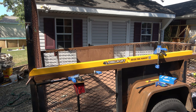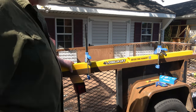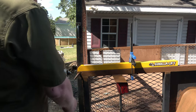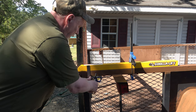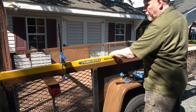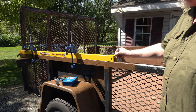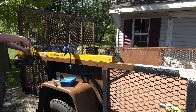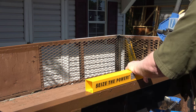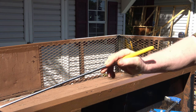Hate to do that, so get it set at a quarter inch. Clamp it — gorilla right side up — slant it, then mark the hole here where you're going to drill for this end. I'm just going to draw a line since I have to retrofit it. Then slide this one up, clamp, mark the back hole, then remove this one and mark this one. Got two holes here — half inch drill bit — one back there and then retrofit up front.